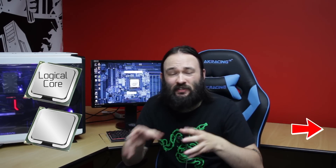The reason why they do this is because of how CPUs handle information. On a single physical core, like on an i3 or i5, when the CPU fires off a task it has to wait till that task completes before it can fire the second one. So sometimes that means firing off a task, waiting for the hard drive to return information, and then starting the second one. While waiting for the hard drive to reply, the CPU has a little downtime — it's just sitting there waiting. Adding a second logical core means that during this downtime the CPU can start a second task, giving a huge increase in bandwidth when processing data.